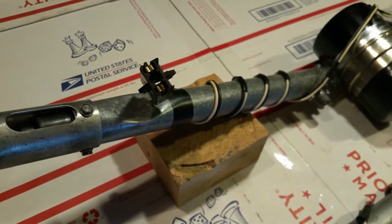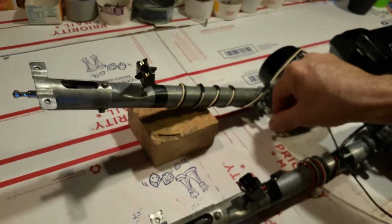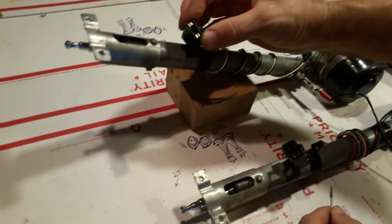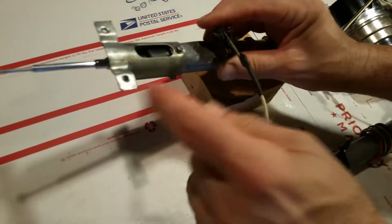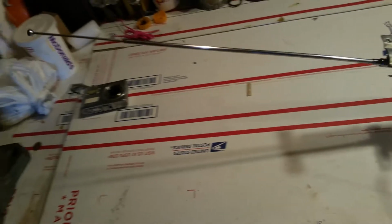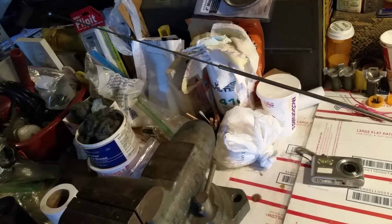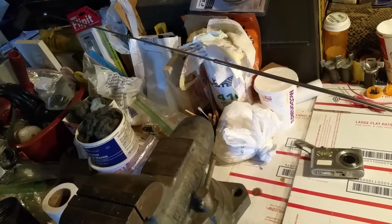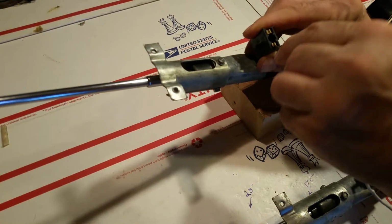So I'm going to go ahead and do a functional validation test. I'll connect it to power by grounding the unit, and then we have the up polarity and the down polarity, so I'll go ahead and connect the up, and we can watch the antenna extend upwardly. Full extension, the full 36-inch extension. And now I'll reverse polarity down here, and we'll get the full retraction.